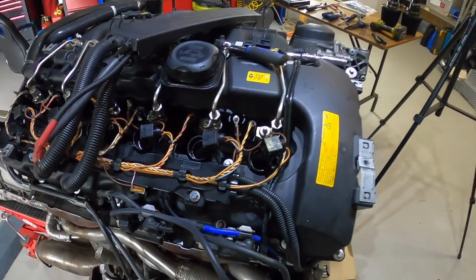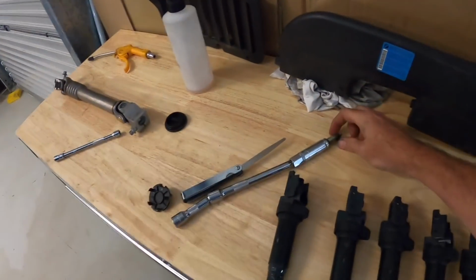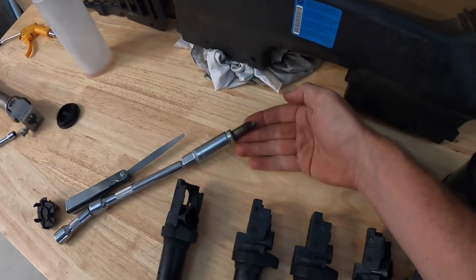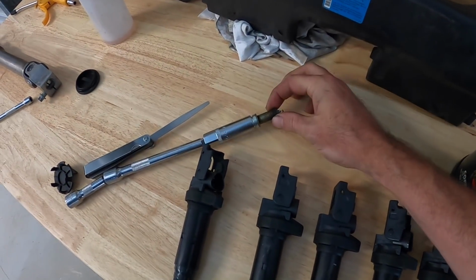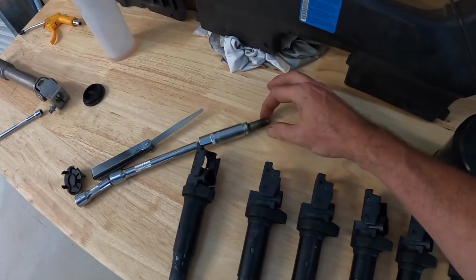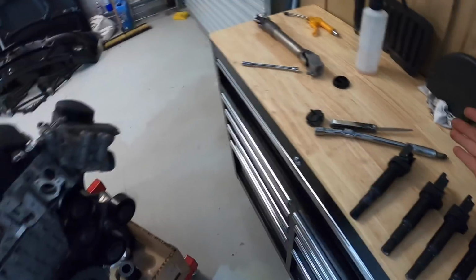And while I was in there, I thought, well, I may as well swap it straight over to the new motor, and that's what I'm going to do. And I have got new plugs, but these plugs have done less than 2,000 Ks. They've been in there since the 17Ts have been in there. I'm just going to visually inspect them, make sure the gaps are still what they were when I put them in, and reuse them instead of throwing them away, because they should still be okay.